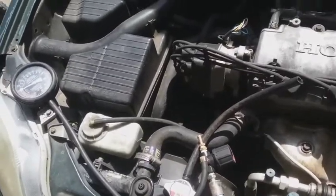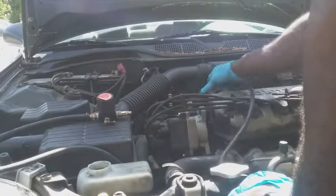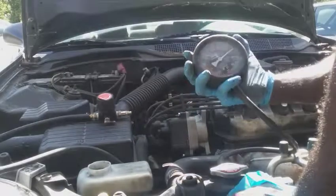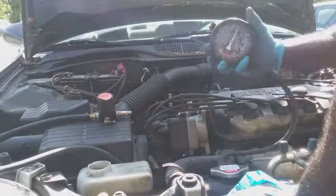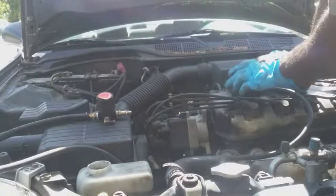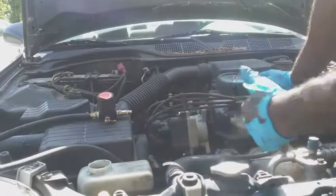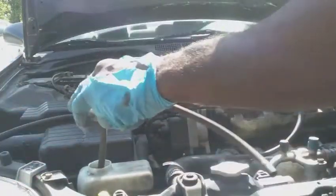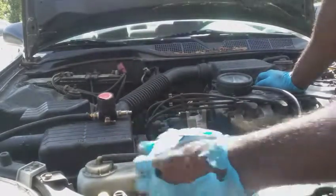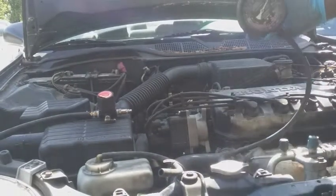That is fixed. I've got the cap replaced and the hose repaired. I've got just over 10 PSI in there right now. I'm going to let this sit for about 10 to 15 minutes, and if it's holding the same pressure then the system is sealed completely. After that I'll go ahead and drain the water and fill it back up with antifreeze. Back in about 10 minutes.